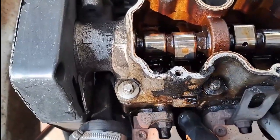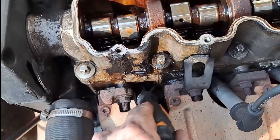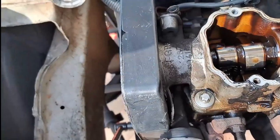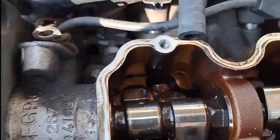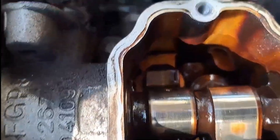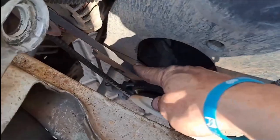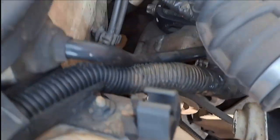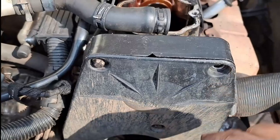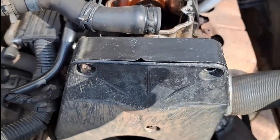Next I prepared to make sure that the timing was correct. I made sure that piston one was at the top and that the valves were rocking so that with my timing marks in place I know this engine is 100% correct on its timing. Next I removed the fan belt by releasing the tension on the alternator, then removed the cover on the timing belt.